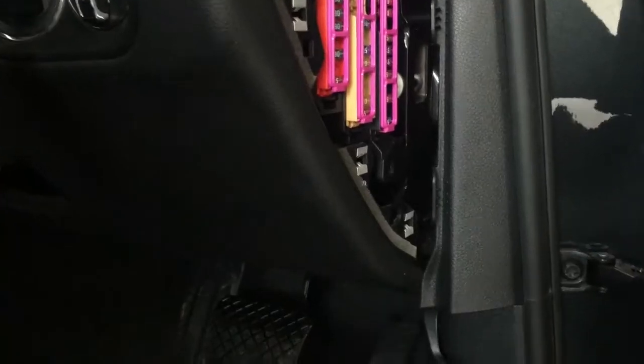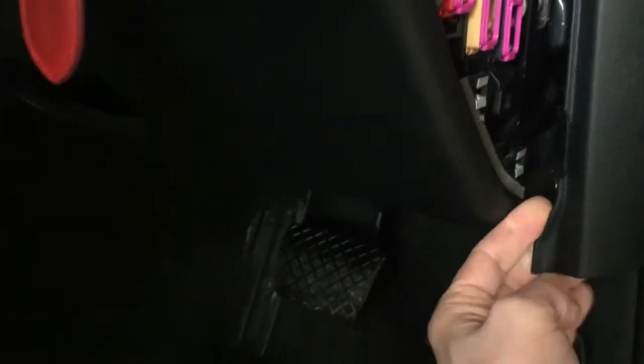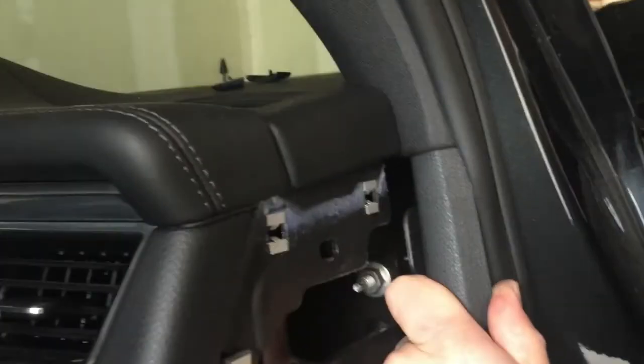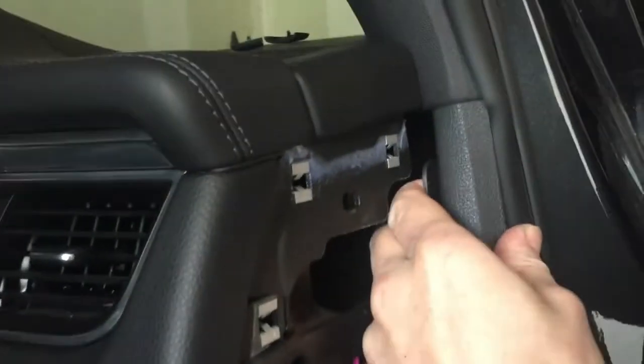The first piece is just a small cut-out — press in there, you can hear it unclip, and there are just a couple of further clips further up. Lever all the way out. There's one last clip in there which just needs to come off, then that piece sits forward and comes out, giving access to this side panel which needs to be released. This one just needs reaching at the bottom, pull here, and it releases. Once it's pulled out it should just pull down. The instructions said it pulled down but I just needed to apply a screwdriver at the top corner to release that top tab.